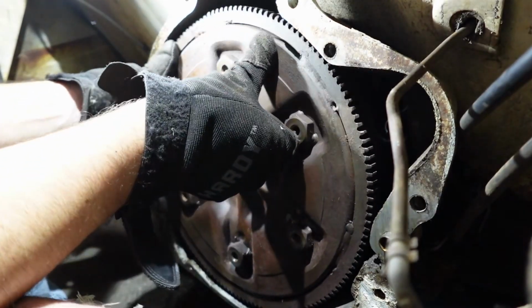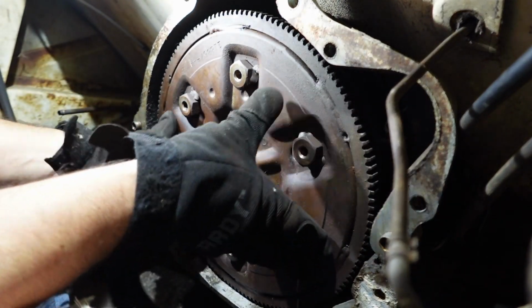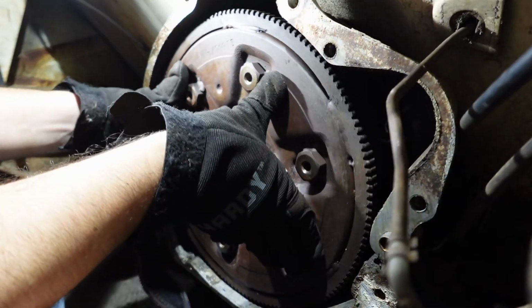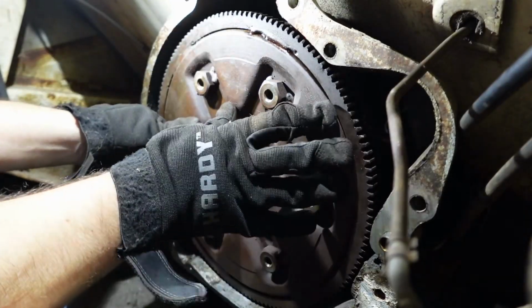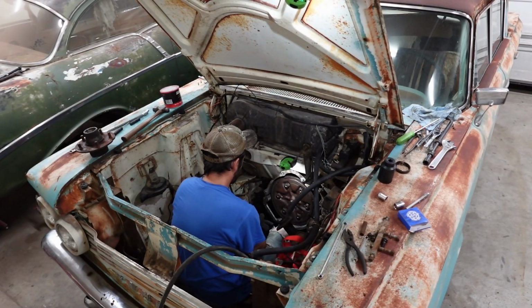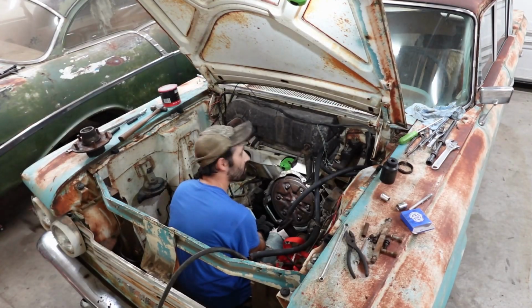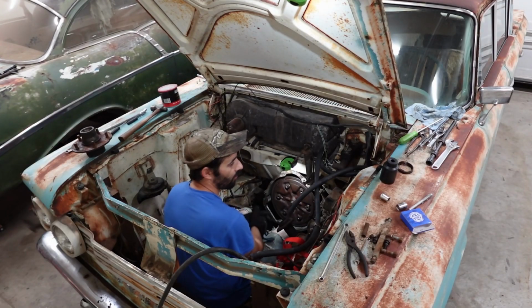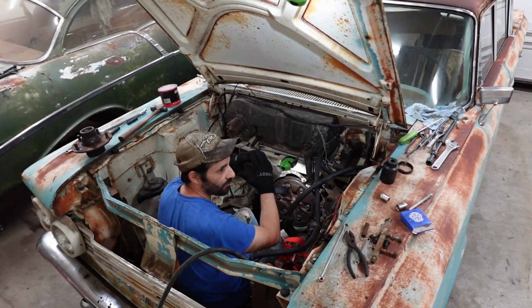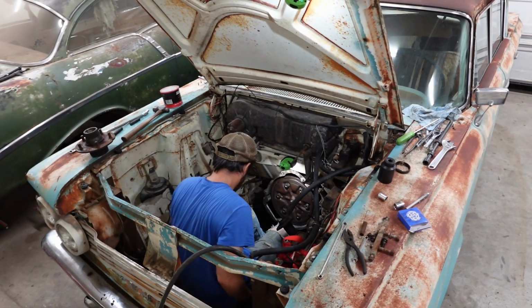Okay, that's not really a clunk. I think, okay, there's a clunk. There's a clunk or two. See, I'm not 100% sure if there were 2 clunks or 3 clunks. There's the big spline and the little spline. I'm rotating here, trying to line everything up inside the torque converter. Okay, regroup so that the amount of things that we destroy is minimal. I think that right now the seal is probably safe and sound. I think that our splines inside the torque converter are on the big splines of the input shaft, but there's the smaller splines on the end. I think that's what we're missing.